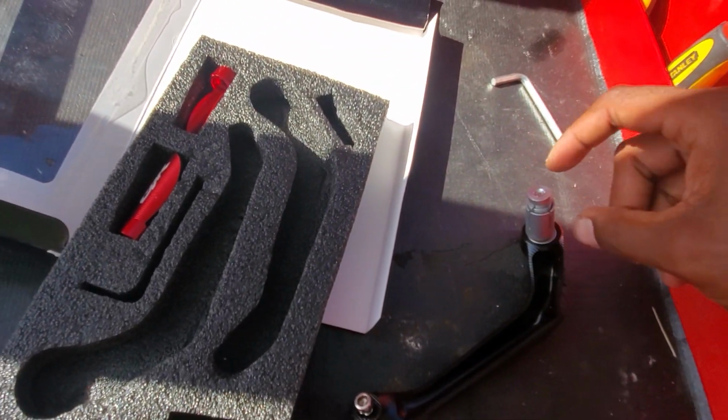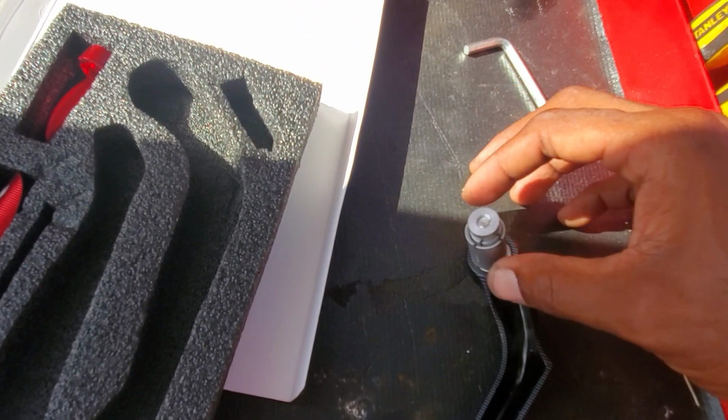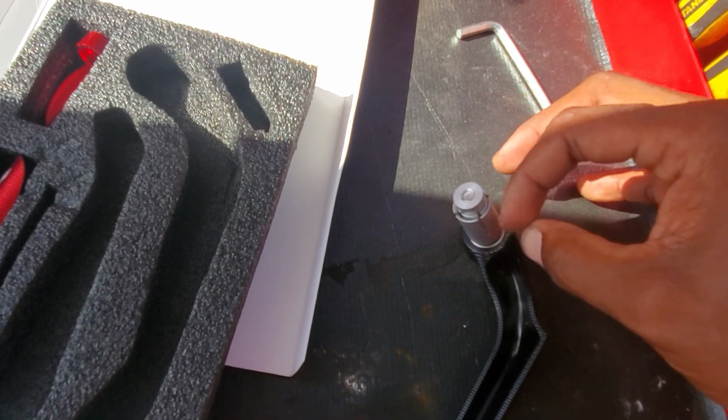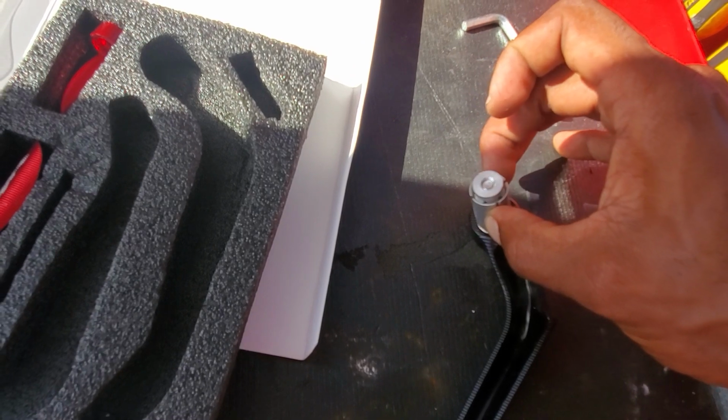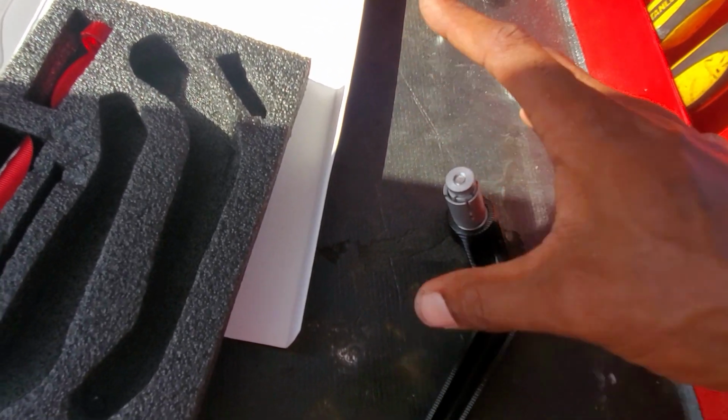Like I said, put my painter's tape, because if you look, sliding like this, it's not gonna grip anything. But with a little bit of that painter's tape, once it starts to expand and this has nowhere to go, it's gonna grab onto the bar end, or the bar itself, and then it's gonna get tightened. As it expands, it's not gonna move.